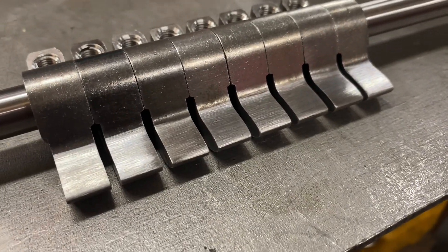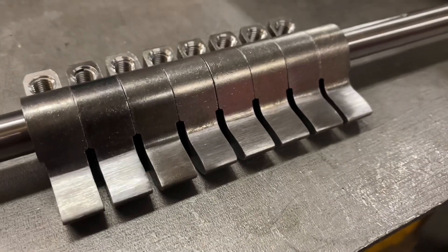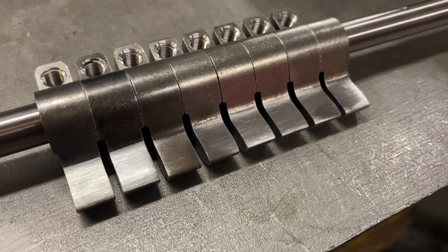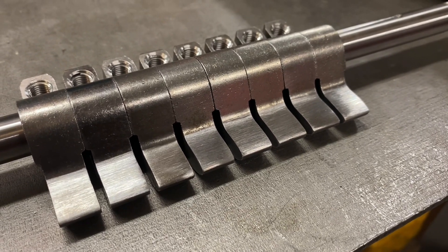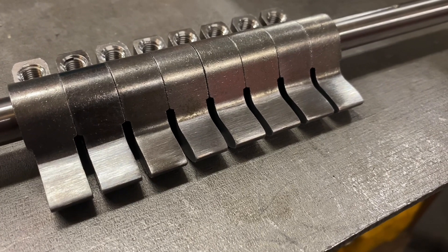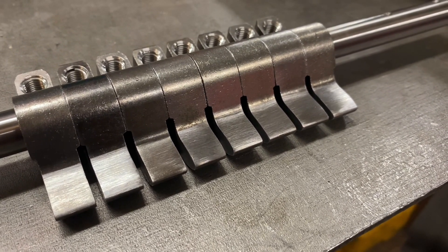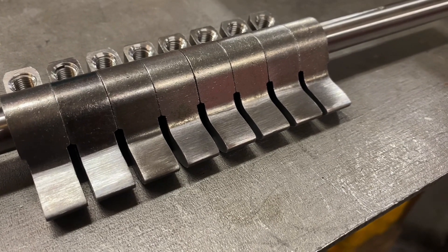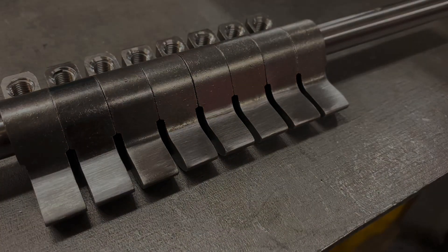So with those 8 rockers done, you can see they're all refaced and all giving within three thousandths of an inch lift of each other. You've also seen how I go through and optimise them. That was only 8 rockers — I've got 10 sets here so I need to go through 80. Anyway, hope you like the video, please like and subscribe, and I'll see you soon.